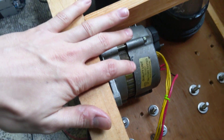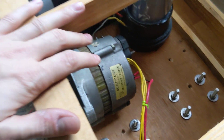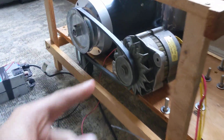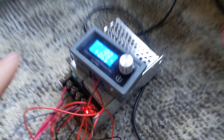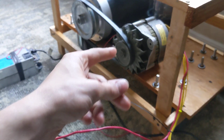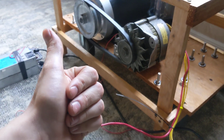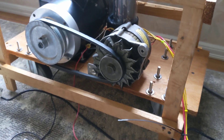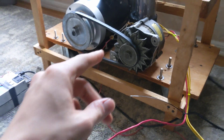I hooked it up — it's connected at the back of the alternator housing. A couple things important to note: the exciter is not controlled from the regulator in the alternator; it's all done with a manual override. I basically took the regulator, scrapped it, and now it's outputting higher voltages.